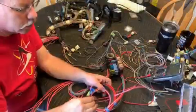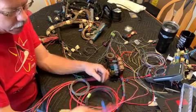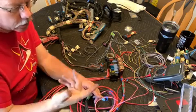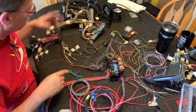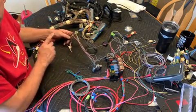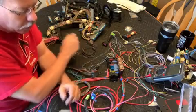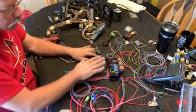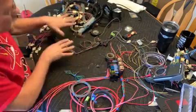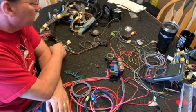So on this system, we have a ground that goes to battery, main power line that goes to battery, and then the orange and pink wire go to the toggle switch that turns the power on. And they'll have a similar purple wire coming in that goes straight to their starter, and that'll be on the push button. And that's it. The engine will start from there because it has power and ECM control. So I would show you hooking all this together, but I just happen to be building systems on 2 different vehicles at the same time.